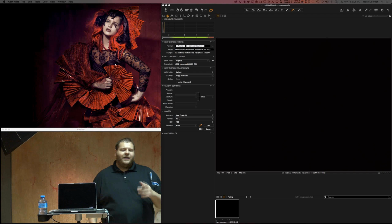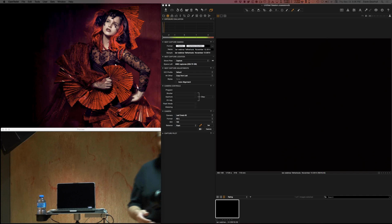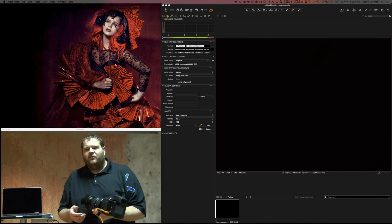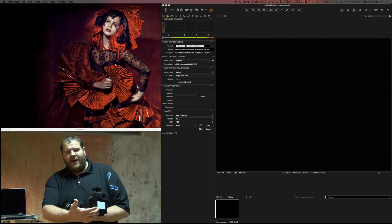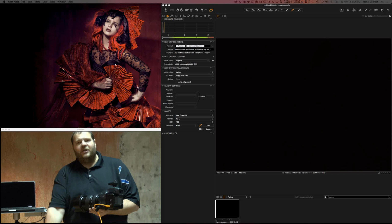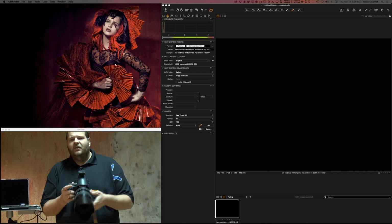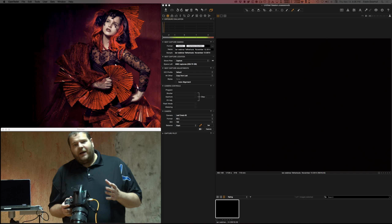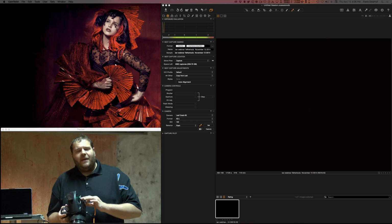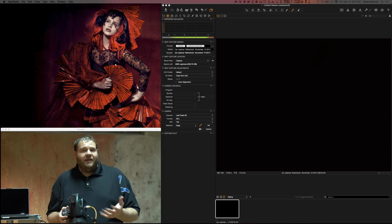Now, if I grab my camera, I will show you very quickly, because this is one that will save your life, or, well, it will not save your life, but it will save you a lot of money. Now, what you can see here, actually, this is my camera that we're shooting with today, and this is a FireWire port on the back, and a USB 3 port here. Now, what you see is the connector goes into the USB 3 port, but after that, the cable will just hang out on the floor, right? Now, with the USB 3 port, they're very, very sturdy, but if you go to like the Sonys or the Canons, the ports are actually very fragile, meaning if you do something like this, it will be okay, but if you do it a little bit wilder, it will probably break off, and that means 600 euros of damage and 6-7 weeks your camera gone.